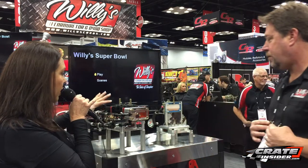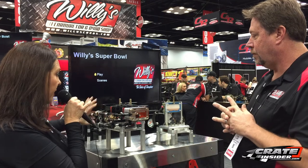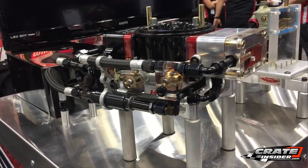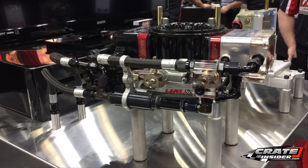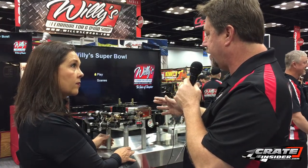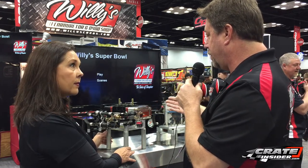That's fantastic. You've also got it set up as a whole system — it's not just the side pieces. You have the return lines and such to maintain constant fuel pressure, is that right? What it does is maintain a specific level set by the height of the wall. As for fuel pressure — it's numb to fuel pressure. With a belt-driven fuel pump you'd normally run a return regulator to keep it from overpowering the needle and seat. Here, we run no regulator, so you'll have 30 to 40 pounds of fuel pressure down the straightaway and it'll still idle below 10 PSI.